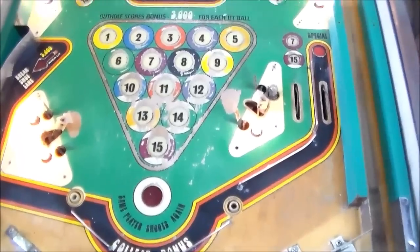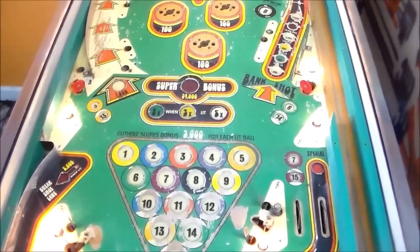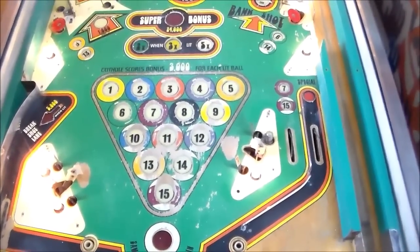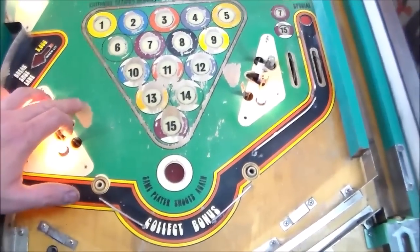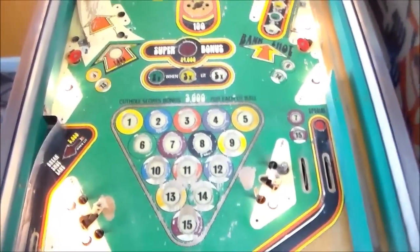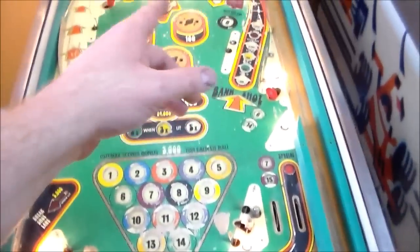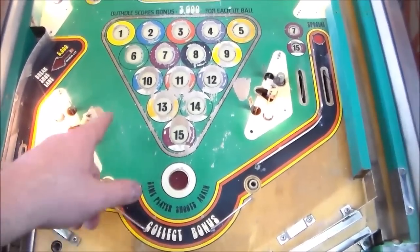We've even got some here that could stand to be repainted, and also the arrows on this part. So we've got a mess here, but we'll see what we can do. I think I'll start with the green first — why not do the biggest one first? The first thing I'm going to do is get a bunch of acrylic paints and start mixing them together to try to get a green color similar to what we're seeing. Now the place where you want the best color match is right here where it's going to be right up against something that hasn't been painted. The green down here might actually be different than the green up there because all of this is faded — some areas are more dirty than others, some have been waxed more. It's a big mess. So I'm going to try to match it down here, and if it's off a little bit up there it won't be as big of a deal because it's farther away from you.